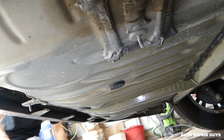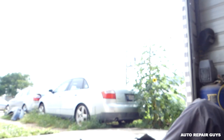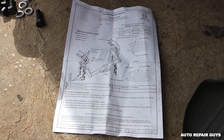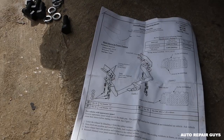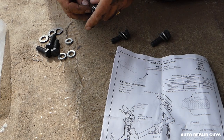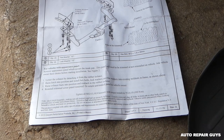We have three more on the other side to remove the same way. Those are actually where the bolts will go — one, two, three on this side, and three on the other side as well. The instructions tell you about how to load your vehicle and other important customer information. We'll need to install a washer and a lock washer on each of the six bolts, and we'll be ready to install the hitch. In our case, these use a 19 millimeter socket, and according to the manual we need 75 pound-feet of torque — but check your own manual as it might differ.